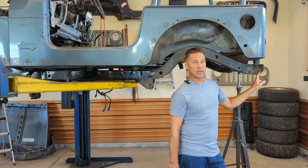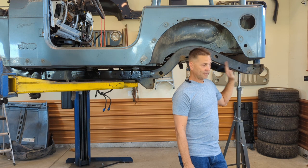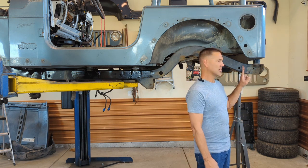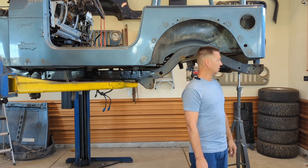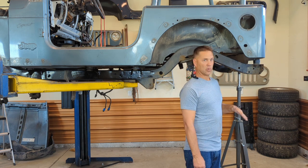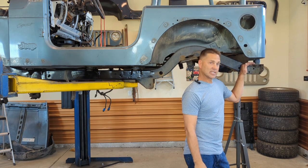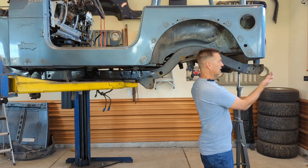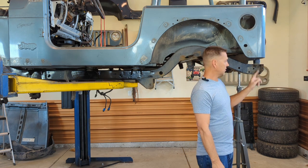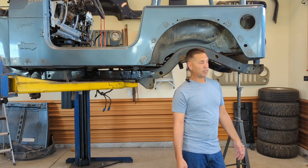Before I get started, I want to let you know that my rear cross member has a little bit of a bow bend because this Jeep's been in a previous accident. So I'm going to cut this cross member off, toss it, and cut the cross member off my old Jeep and put it in its place. What's critical with this entire process is that your cuts are absolutely identical on each Jeep. You don't want them level to the ground — you want them square to the body mount bolt.